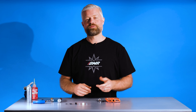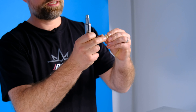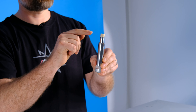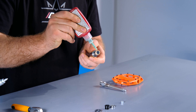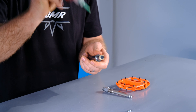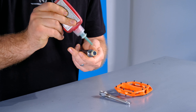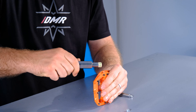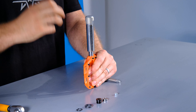Now you're ready to put your pedal back together. First thing we're going to do is fit our new DU bush using the V12 service tool. The bush has got a chamfered end — that's the end that needs to go into the pedal first, so put that on the outermost part of your tool. Before we fit it, we're applying our bearing fit — Loctite 638 — putting a small amount around the bush. Then we can insert it into the pedal and make sure the bush is pushed all the way home.